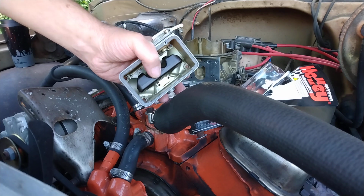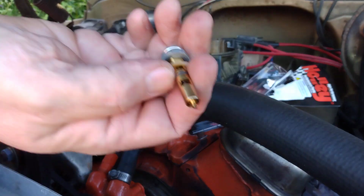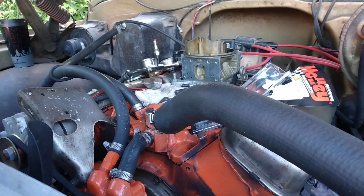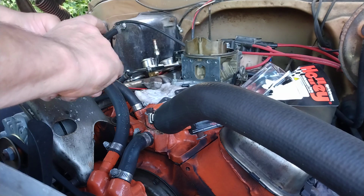Up quite nice there. Yeah, do yourselves a favor. Always take out that whole fuel inlet thing, especially if you're changing a float, because it's not worth it. Take it out, then it's out of the way. You can check the operation of the float once it gets in there, make sure it moves freely. And, wow.